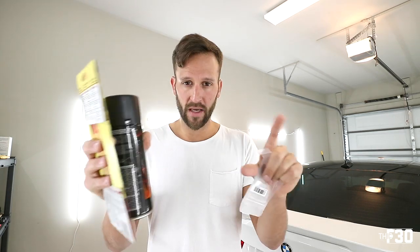So this is an add-on that a lot of people do — the red start stop button and the red M button on the E90 M3. We picked up some sandpaper, very fine grit — I have a 400 here — as well as some other grits and some satin black spray paint. The reason for the sandpaper and paint is because the inner piece on the steering wheel actually goes bad and starts to bubble over time; whatever BMW used for that just fails. I've heard that people just sand it down, spray paint it, and it lasts longer than the actual OEM one. The ring around the start stop button also has a bunch of chipping, so we're going to sand that down and spray paint it black as well. There's a silver ring in there too that I think will just look better in black.